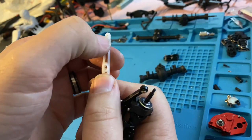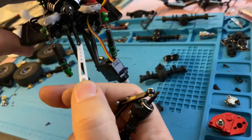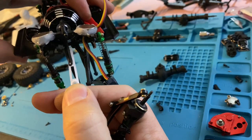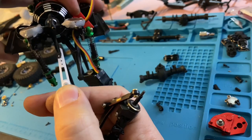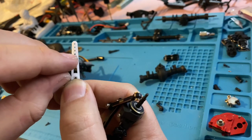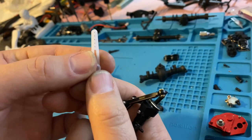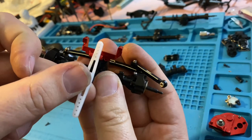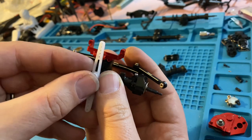I'll also have an adjustable mounting point for my limiting strap. I'll be able to mount it wherever I want within that. We may end up having to cut it off depending on if it hits on things, because realistically we only need one hole. We'll put the hole here and use either this hole or we'll see how the adjustment goes. Just wanted to show how I plan on doing my four-link screw mounts as well as, at least for the front, my limiting strap.